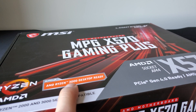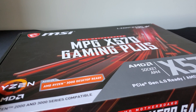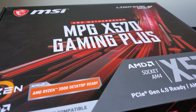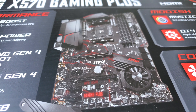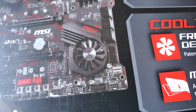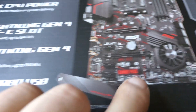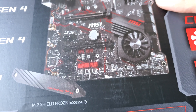There's a sticker here that says it's Ryzen 3000 Desktop Ready, so I'm going to guess the BIOS on this particular board was probably not updated to support the latest generation. A quick BIOS update will allow you to do that, and I do know that some MSI motherboards allow you to do that without the need of a CPU or memory. This board has a little chipset cooler, pretty common with X570 boards, and a couple of M.2 slots — one up top for max speed supporting Gen 4 SSDs, and one below that will be Gen 3.